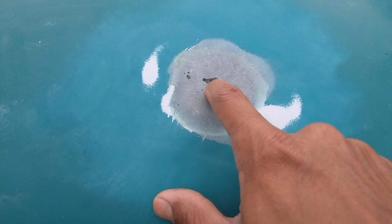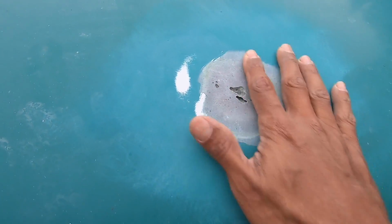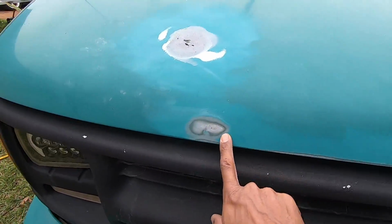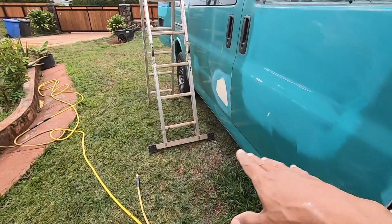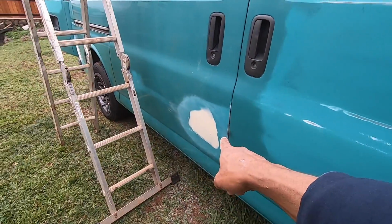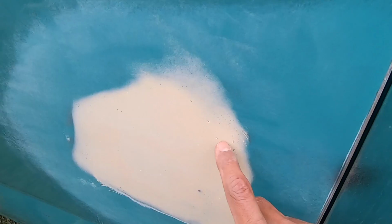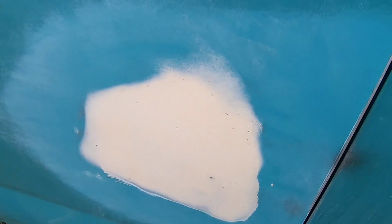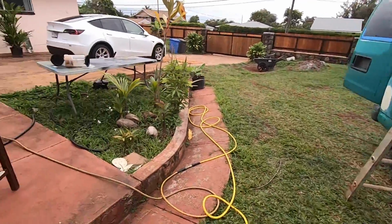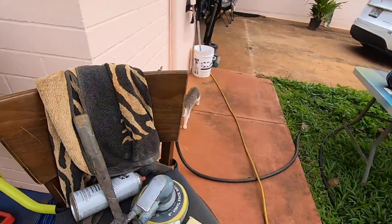Little hole right there, right? We laid our fiberglass. This is super tough. Just gonna skim coat it with body filler. Skim coat that one, skim coat this dent we missed, and then just go over some of this. I don't think we're good here. This is done, that one's done. Maybe we'll just put a skim coat over the little pinholes there a little bit, and then we'll do the tube, we'll do the roof, and yeah, keep cranking.